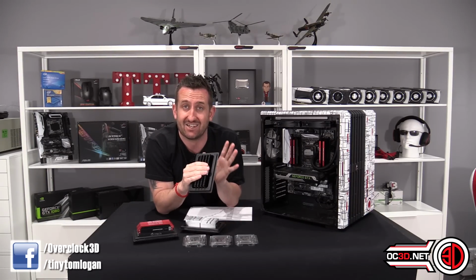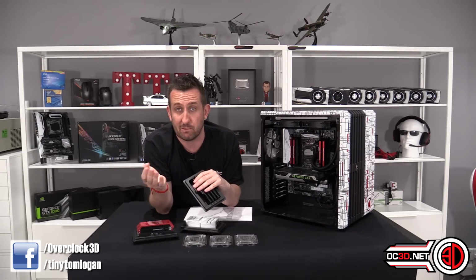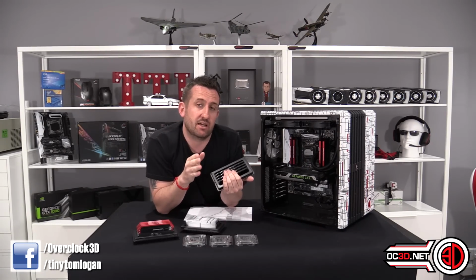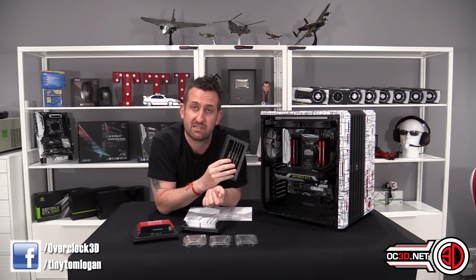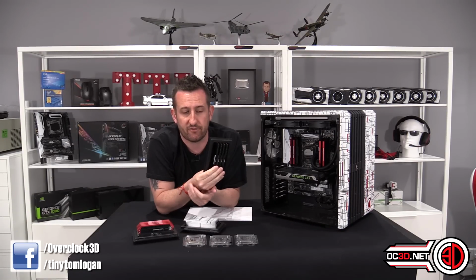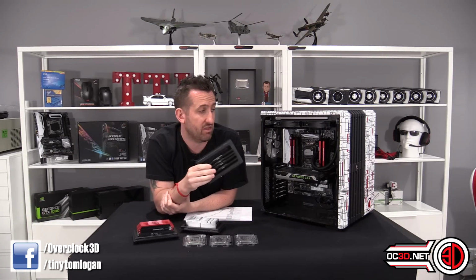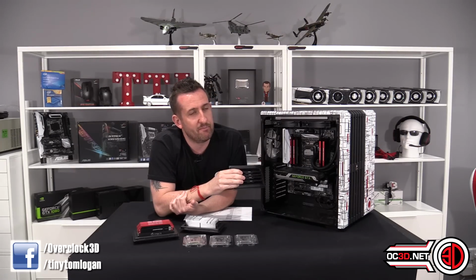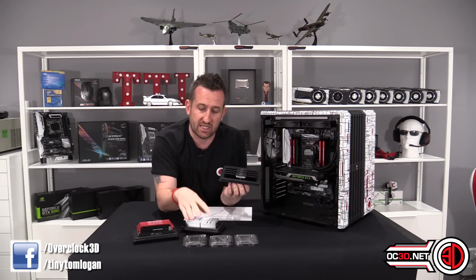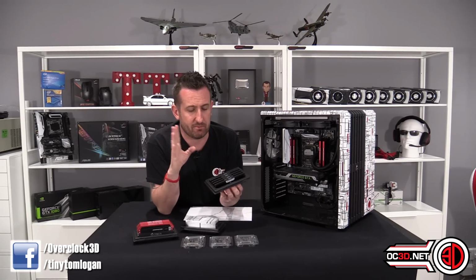We run quite extreme kits because it helps us distinguish, not so much between the CPUs at the start, but later on when we start talking about motherboards. By running all these different memory kits, it genuinely helps us distinguish between the boards which are better and not. Because when it comes to memory compatibility, it comes down to the board and, more importantly, the BIOS itself. So with 2800 megahertz, for our stock run, I literally go in, click XMP, and come back out. Although with these, I had to manually make sure they weren't going to be turboing up to the 40, because that's not processor performance. That would have been artificially inflated by the Asus BIOS. So I was trying to make it fairer as a baseline, so that when we do the boards later on, you'll understand why it's running a bit better. Anyway, you get what I'm on about. So 2800 megahertz.